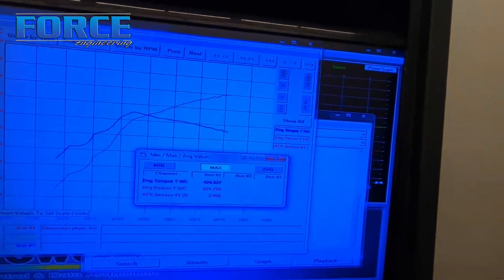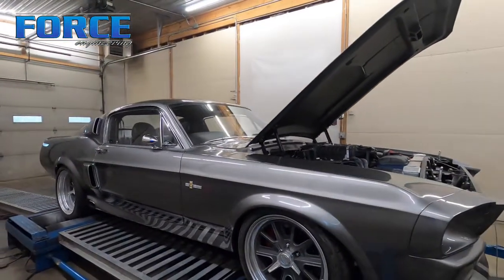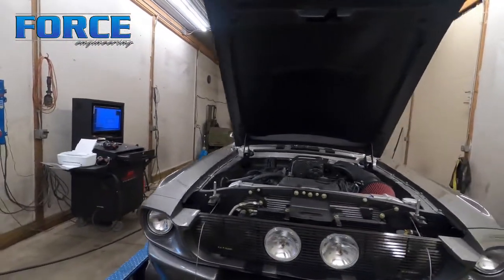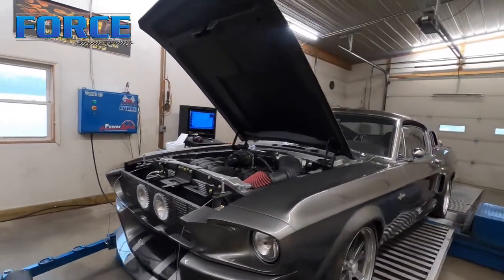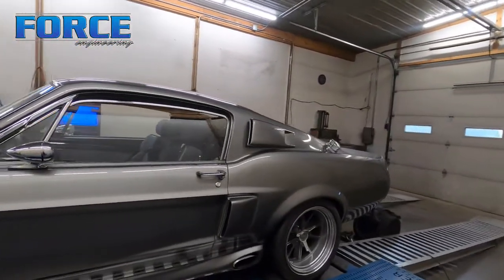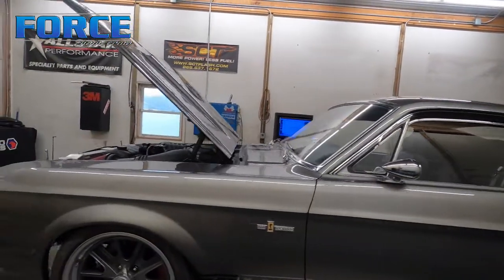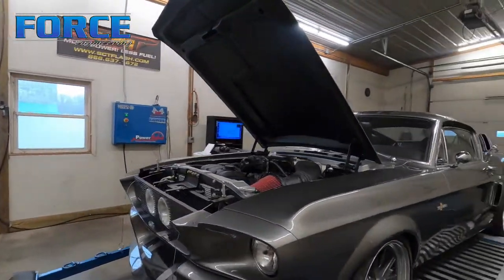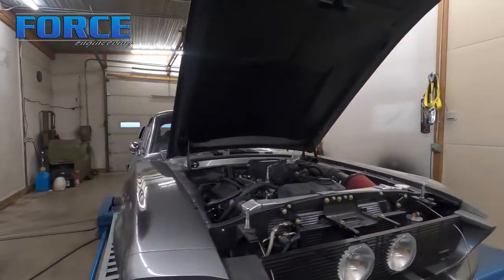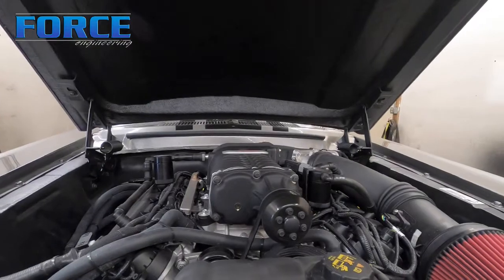Go get ice cream in it kind of thing. I don't think it's a bad number really. Keep in mind in my personal car, the locked 6R80 to an unlocked turbo 400 with a PTC 16 zero converter — that locked to unlocked conversion was worth 150 horsepower at the tire on the same boost level. Based on injector duty, this thing's got a set of 52s flowed at 43.5 PSI with 58 pounds of base fuel pressure, making it about a 60-pound injector. We were at 89% injector duty at 7100, which calculates to a mid-700 flywheel mark. So the drivetrain loss is definitely significant, which isn't uncommon with a looser aftermarket converter.